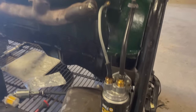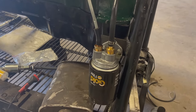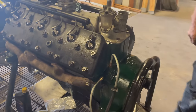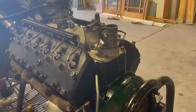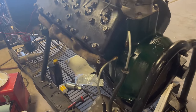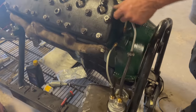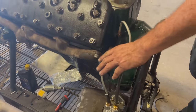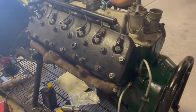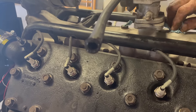Wait a second, is this an oil filter back here? Yeah, put an oil filter on, no water, but we put oil on it. So it's got the oil. Now, what happens on an original Zephyr? Does it have an oil filter? Yeah, it has a canister filter up there. There's a screen. For the bench situation, you want to make sure you're catching any debris that might have gotten in the engine, or from the shop, debris from anywhere. Gotcha.